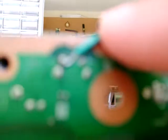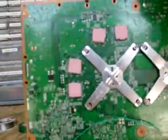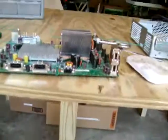You're going to run your wire to about right here where your sync button is. Strip the wire using tweezers or wire strippers. Hold your motherboard up with the fan placement down — there's an opening at the bottom. Your power plug is on the bottom right, AV's on the bottom left, Ethernet's on the bottom left. You're going to solder the 26 gauge wire to those four points right here — you want to solder to the top left. That's the sync SW button, and once you solder that, it will control the changing of your modes.